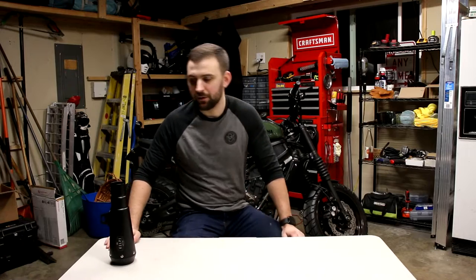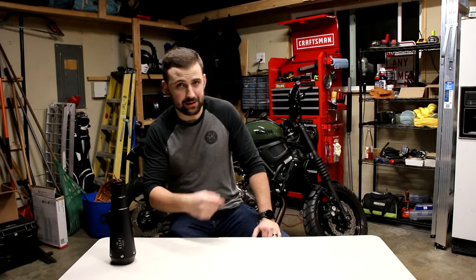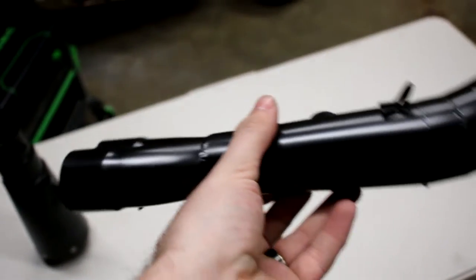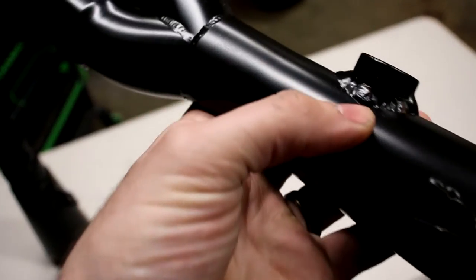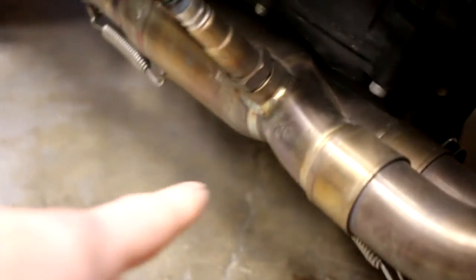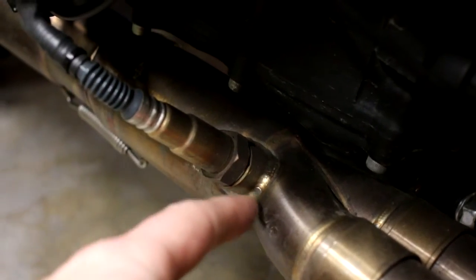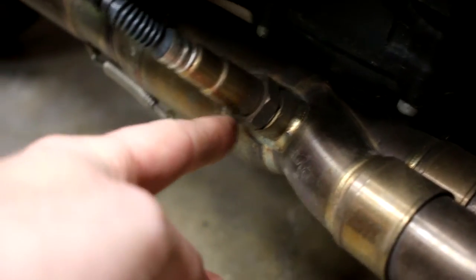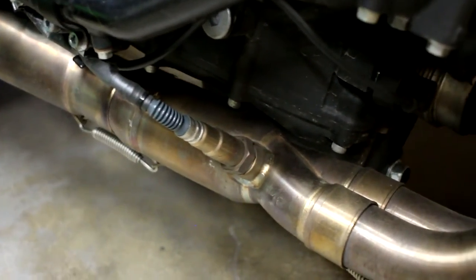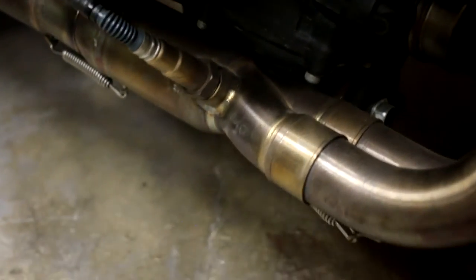I had to order the stainless steel pipes and Cerakote them myself because I have an active tune system on my bike, and that requires a larger O2 bung. When I originally got this, it was stainless steel — I had to weld a new bung on there and then Cerakote it over. So on my SE Project exhaust, I had to do the same thing: I had a bung welded onto the pipe for the larger O2 sensor. The factory O2 sensor on these bikes only changes the fuel-air ratio at idle, whereas this active tune O2 sensor will actually tune the bike while it's running at all RPMs.